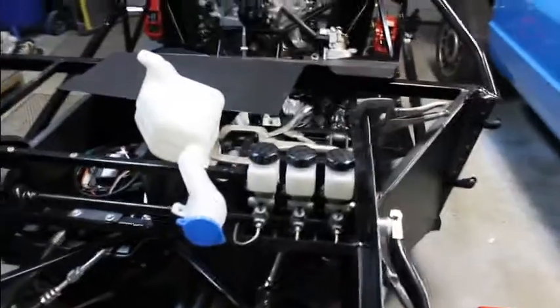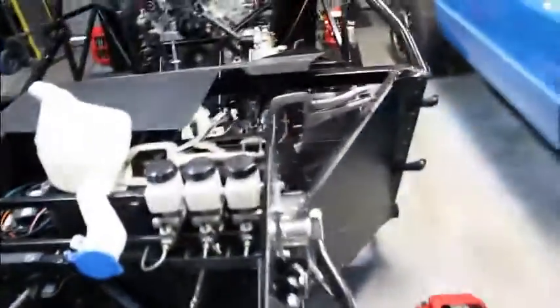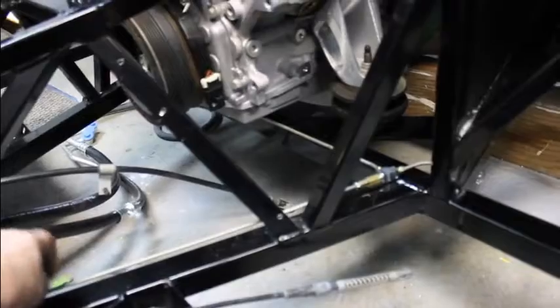Pretty much got the brakes all routed. I got these lines tightened up, all tied down. I want to check and make sure there's no rattles anywhere — make sure the tubing isn't rattling against the body. Got this part done. I still got to take this panel off, but I just riveted that to the panel and that's done.